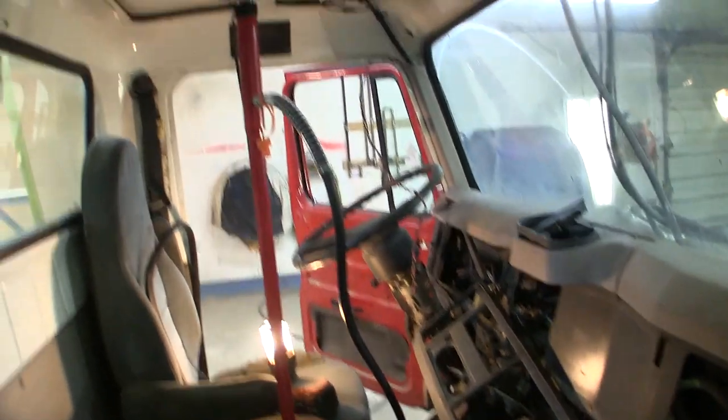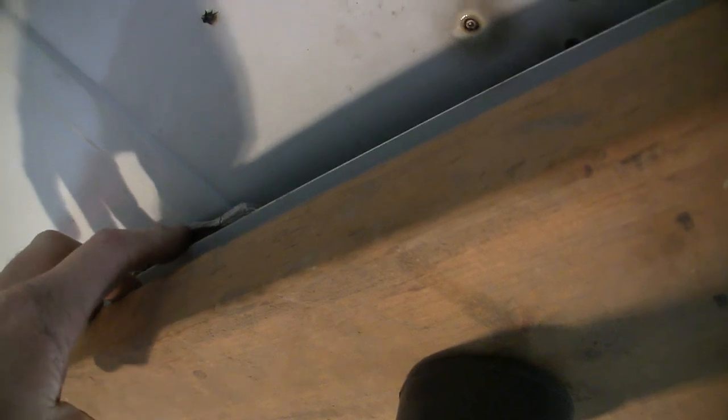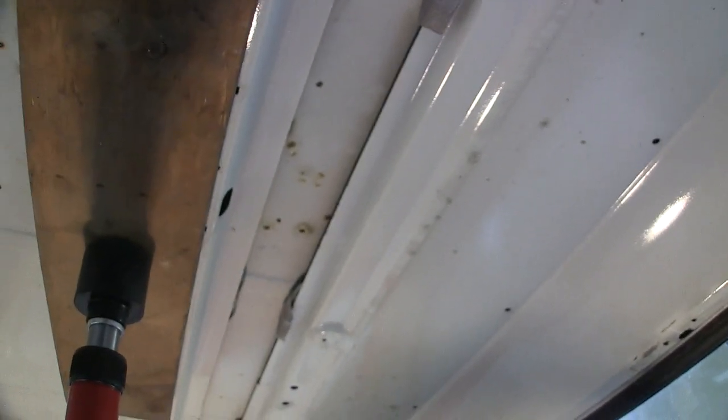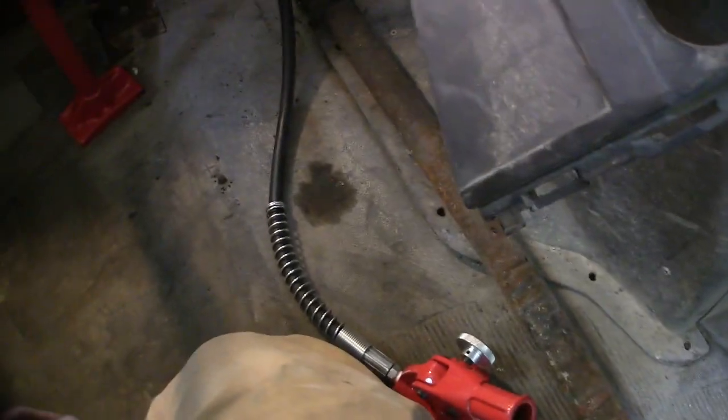I've been fussing with this for about an hour and a half now, and I've done the best I can. We're inside here now. I have a support beam that runs across the top, and I have the porta power with a piece of wood holding it up. It's buckled down and I can't get it to bend up and stay. This is the dead center of the roof where it's caved — I have about a half-inch gap between where it touches. I'm probably going to end up putting some structural foam up there to hold it up. I've shrunk the heck out of this and I can't get it to stop oil canning. It's not bad like it was, but anything short of tearing the roof skin off, I think that's where we're at. This is a work truck — I just want it to look better than it did before. The porta power is working good; you don't even have to put the handle on the jack, just use your hand.